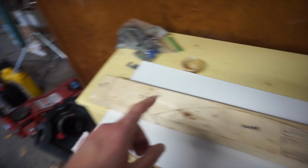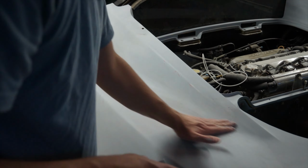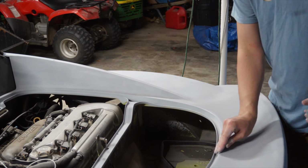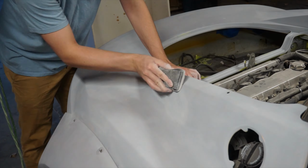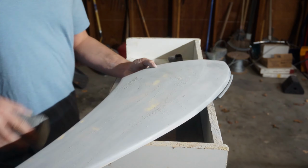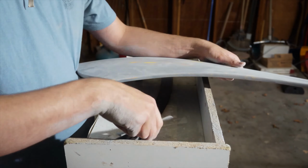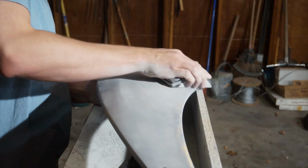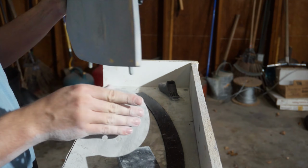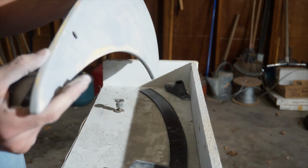But in the meantime, I sanded the newly primered areas of the clam and radiator sill pieces to get close to a perfect surface so that I could do that last spray of primer before paint. I'll be leaving the sanding of that last coat of primer for all the panels in the next video when we do all the painting of color and clear coat. We'll do this all before the paint. As this video is already long enough, I gotta cut it off.